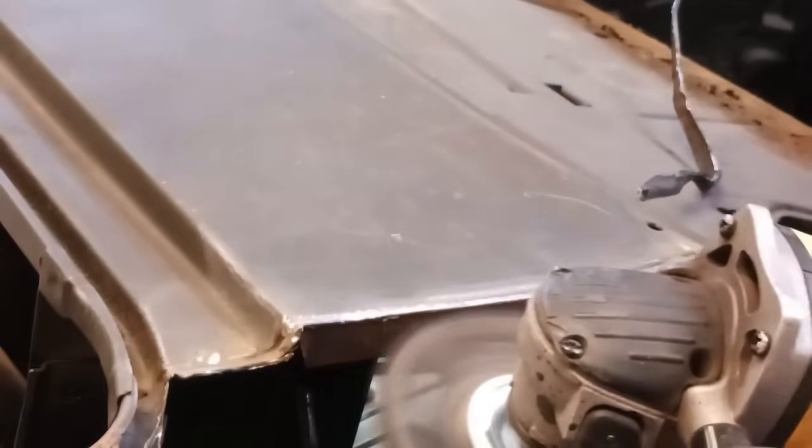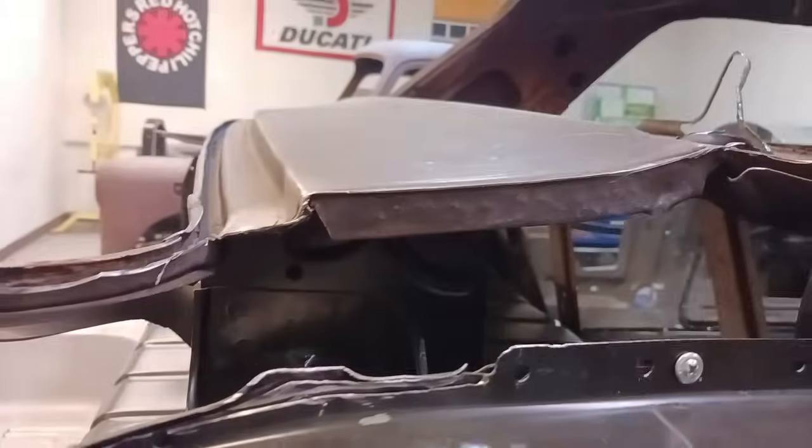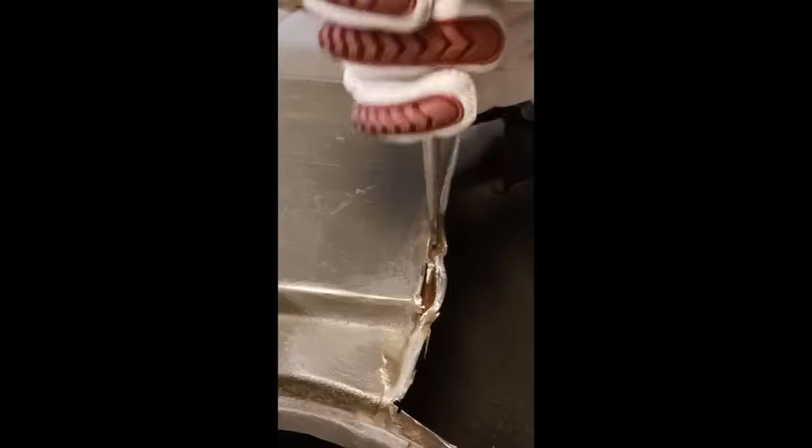And now we're still going to have to deal with our flange. Now, this is the quarter panel flange to the filler panel flange. They're still tight together with all of those resistance welds from the factory. If we tried to drill each one of those out, yeah, it's going to be a big mess. So this is my preferred method.